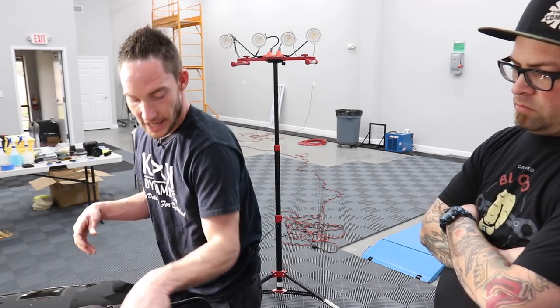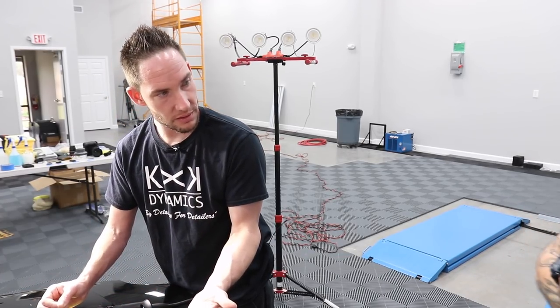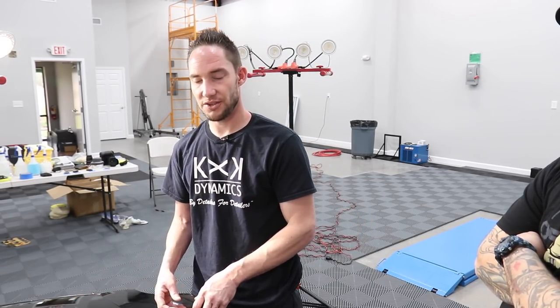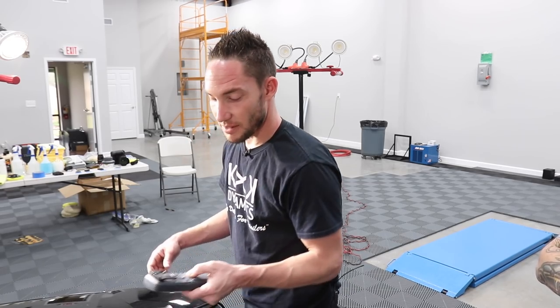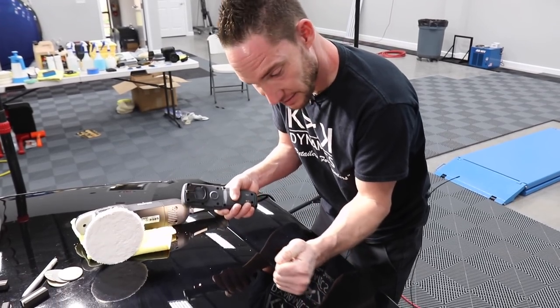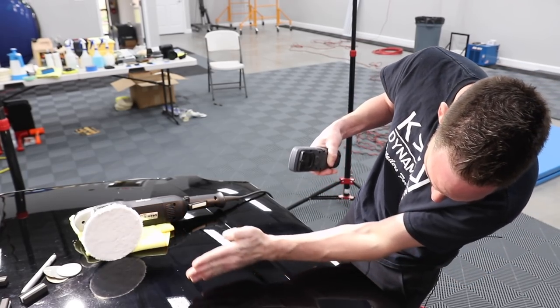What I just did is what normally is used for something like SMAT technology in Meguiar's, where the abrasive is essentially already broken down into finer particles. But I just did it with a diminishing abrasive. So the thought process is that I'm able to rapidly remove the scratches with a consistent, fast pattern.